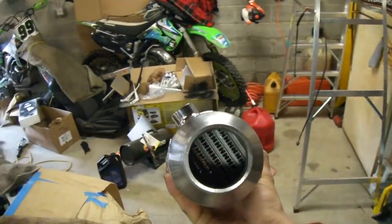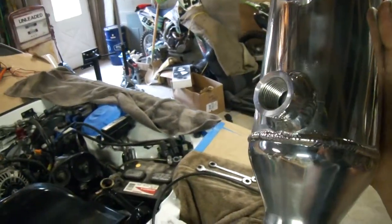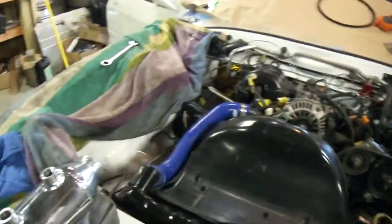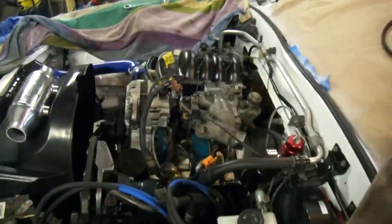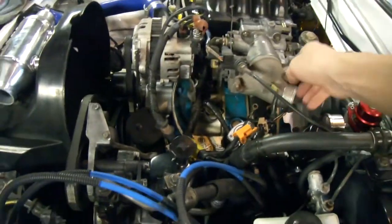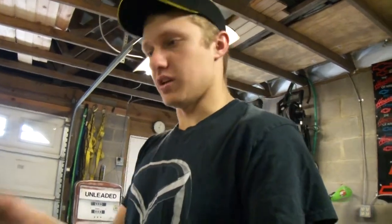The bullet intercooler has got all the fins in there - we got two three-quarter NPT fittings, or at least so I was told, but those look like they're half-inch NPT fittings, so I'll have to check that because I want to put barbed fittings on this. Ideally it will sit right here, and the lines will run down in the shroud and the intercooler pipes can come up and over and around. Also, I can't fit this inlet, so I ordered a Rotary Works inlet that goes straight and then I'll snake my pipes off of that. It's coming together - basically just got to button up the coolant stuff and fix some wiring, then build the intercooler pipes.